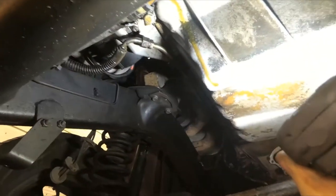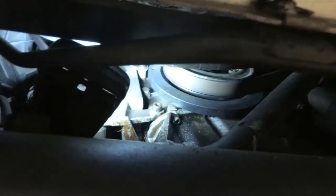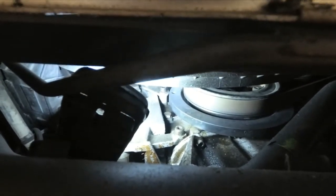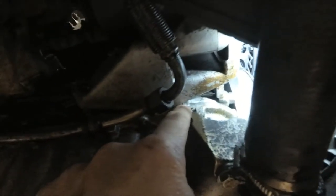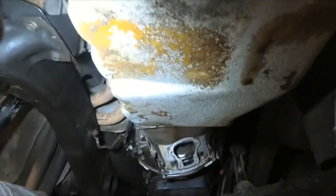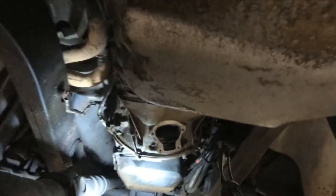I also notice a trail running down from the front — it appears that something's leaking on the front of the timing cover. I'm at a loss as to exactly where this oil is coming from. It could be from the lower section of the timing cover, or from the joint between the timing cover and the engine block at the front — though I know it's not coming from the upper section of the timing cover and that gasket that has a tendency to leak. It's definitely running down the front side, and you can see evidence of new oil. That's the majority of the leak, with very little oil accumulated on the bell housing after running for about an hour at fast idle.